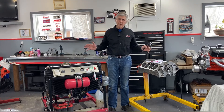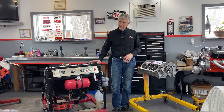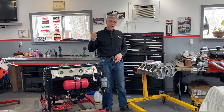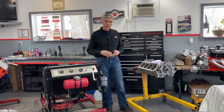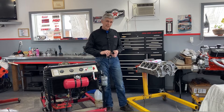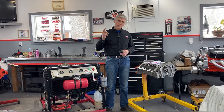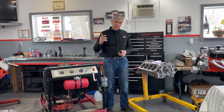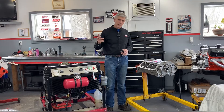This engine is going in a 1970 Pontiac GTO restoration, and Mike wants everything to be perfect. So we decided to fix the problem. We took the heads off and put a head gasket in that's only 25 thou thick. When we measured the gasket that I assumed was 40 thou, it was 65 thou. By going from a 65 thou head gasket to a 25 thou head gasket, we improved the static compression from 9.1 to 9.8 and change. That's a big change.